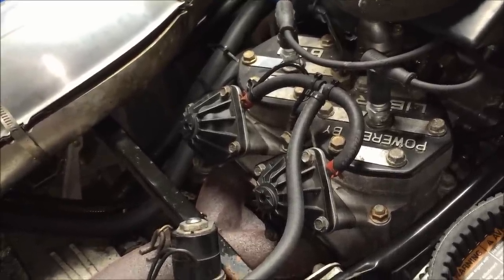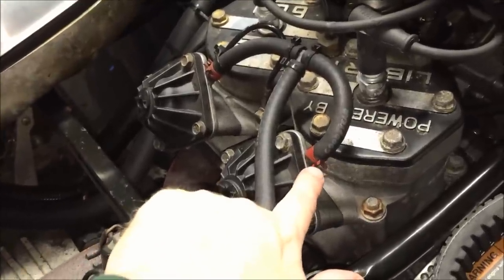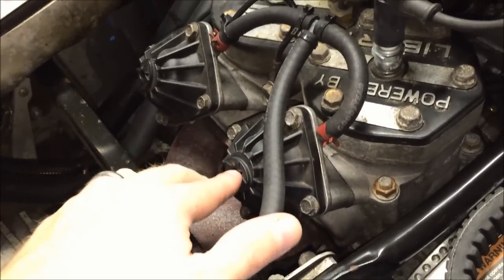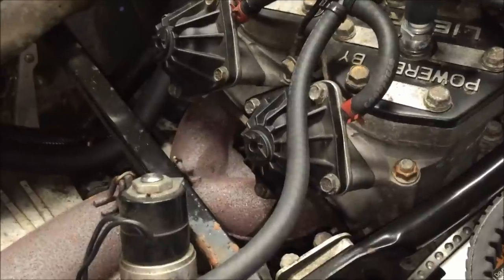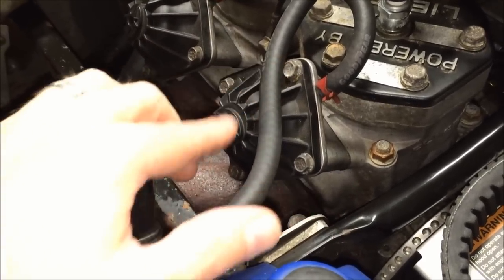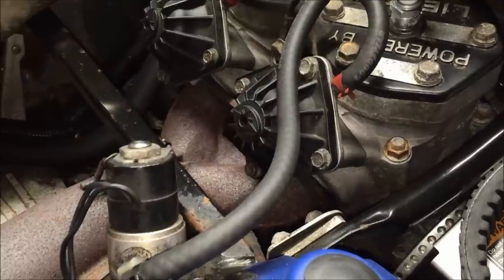Whether it be in the IQ chassis or the fusion chassis like this one. The first step is there are a couple of hoses held on by spring clamps. You're going to remove the other hose first, and then looking at the valve assembly there are four bolts — the only two you're concerned with right now to remove the assembly from the block are the two on the outside, one here and one here. The two at twelve and six o'clock are not to be removed at this point because those are just holding the plastic cap onto the assembly.